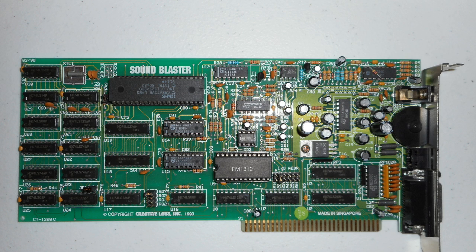It's really easy to configure, so if you don't want to muck around with plug-and-play managers and mixer settings and all of that, you'll really like this card. Just set a few jumpers, off you go. You might have to set the blaster variable, but even without it, most games will actually work.